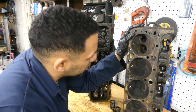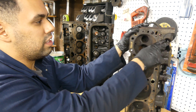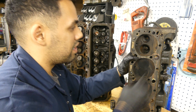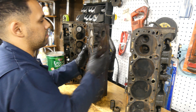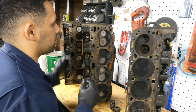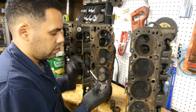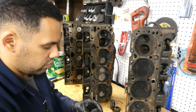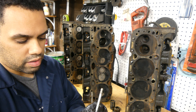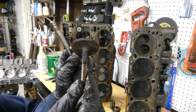As we can see, if we tried to use this cylinder head we would have had some sealing issues with the carbon buildup. At minimum this would have needed a valve lapping, and most likely a valve job. This cylinder head here — we have the intake and exhaust valve — we'll bring those up to camera and pull these two valves out.